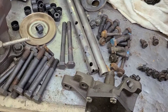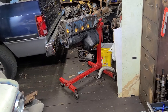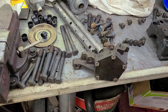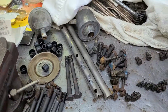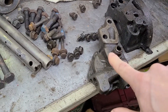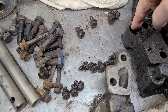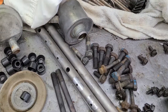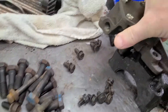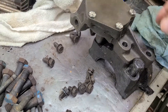We're back. Here's what you need to pay attention to - this portion of your oil pump has to go into that hole right there on the number five main cap. When you're putting it on there, you're going to have your pickup tube on here. When you put it on there, you're going to want to set the oil pump down in there - it's going to want to tilt, so just work with it a little bit until it socks down there just like that. It's machined to go in there.